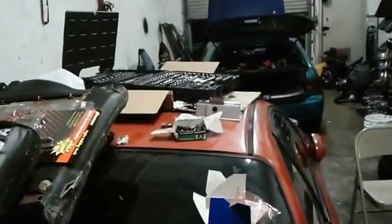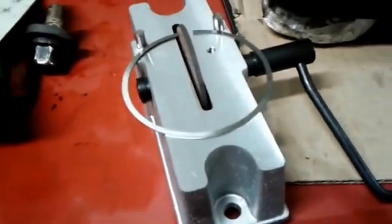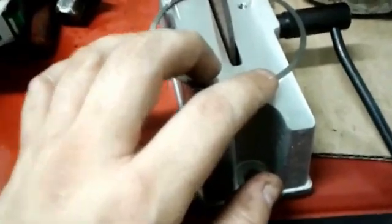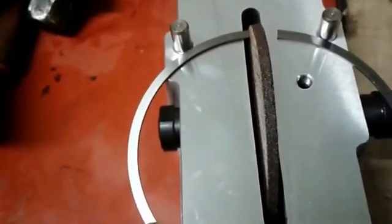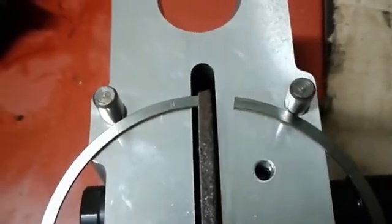I'm going to get my rings out and get ready to use that ring grinding tool. I've got my little tool set up and I'm pumped — I've been waiting forever to use this thing. My wife bought it for me as a Christmas or birthday present. I've always had my eyes on it but it was expensive. Normally I'd take my dull file and hack away at it until I got it where I needed to be, but from now on I have this fancy tool to keep the cut perfectly straight. I'd say it's the best money ever spent, but my wife spent the money, so it's the best money she's ever spent. You lay the ring in there so it hits the post, that way it doesn't move, and then I grind away.